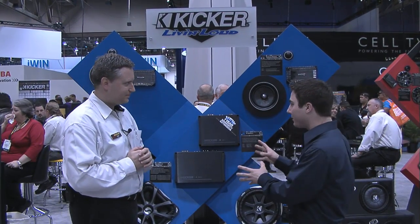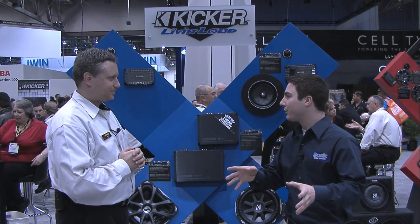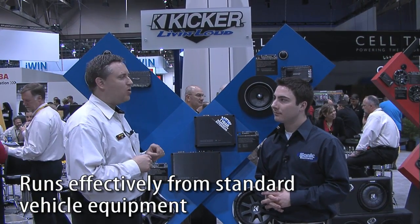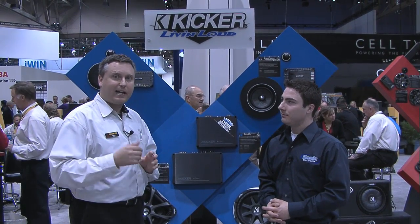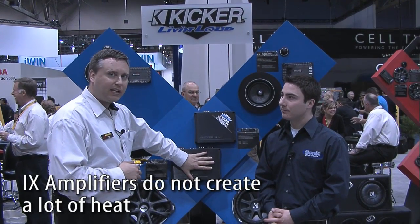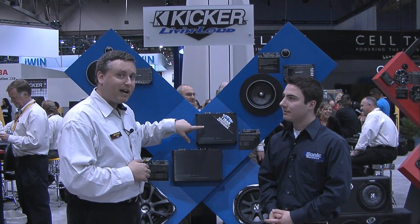So with waiting that long, what does this amplifier have to offer? What makes it different than some of the other class D amplifiers out there? First of all, it's extremely efficient, which means you can run a standard size power wire with a factory alternator and a regular car battery and still get a ton of power in your system. Most amplifiers, class A and B specifically, generate an awful lot of heat, and that heat is actually wasted energy. When this amplifier is running at 500 watts RMS continuous real power, it is simply warm to the touch — room temperature. You can hardly even feel this thing heat up. It's taking all that energy from your electrical system and turning it into music, not heat.